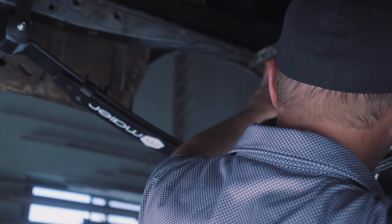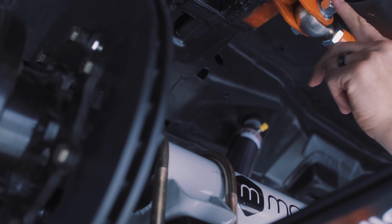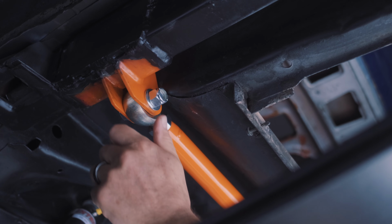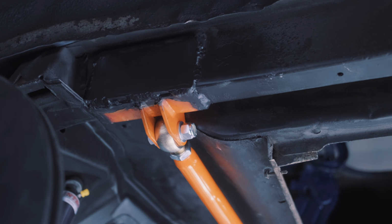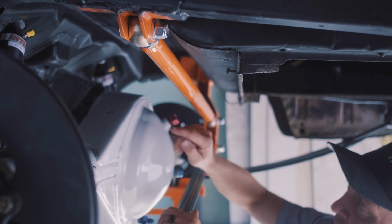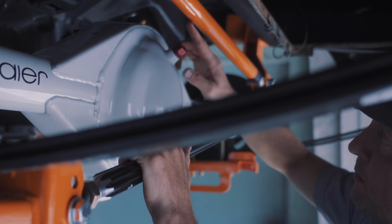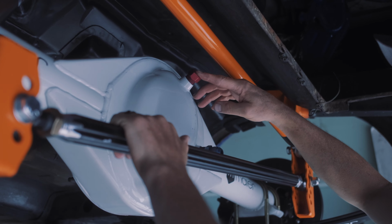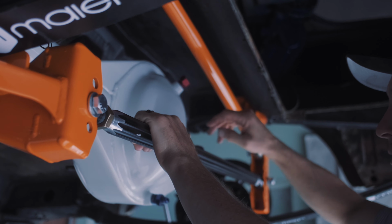This bracket here doesn't have too many options. It's relatively close to the sheet metal here, and there's not much adjustability there. What's most important is this cross tube has a kink in it so that you can clear the back side of the housing. So I'm going to end up putting a plug here, or actually I may end up putting a fitting that comes out at an angle just so I'm sure not to hit this back bar, but I just want to use this as a breather. If I have issues with clearance, I may use one of these others as a breather, but one will be a breather, one will be a fill, and one will be a drain.